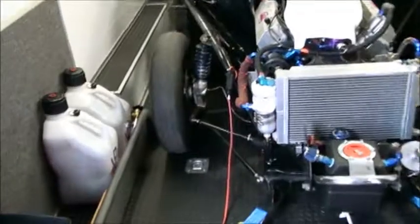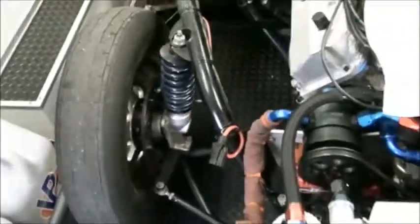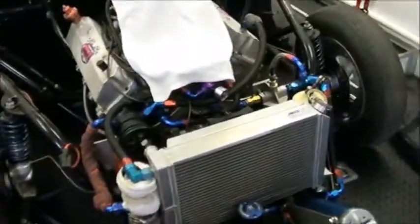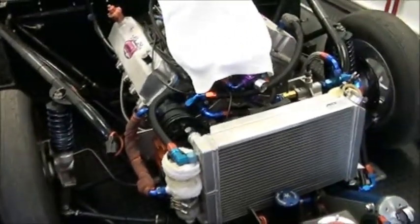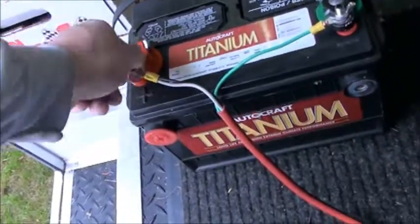The next question we get is: why did we put the female part of the extension cord on the car versus the male? That's actually a very good question. On this car we also run an oil heater, so what I wanted to do was eliminate the possibility of one of my crew members accidentally plugging up 120 volts to all of the DC components in the car. I would recommend this for anybody that's going to make one of these — put the female part on the car, the male part has the power. That does mean that while transporting or between rounds, make sure the box is off or disconnected during transport, whatever's easiest for you.